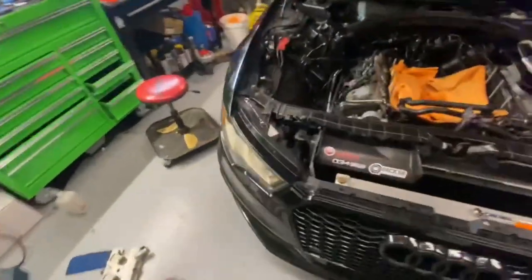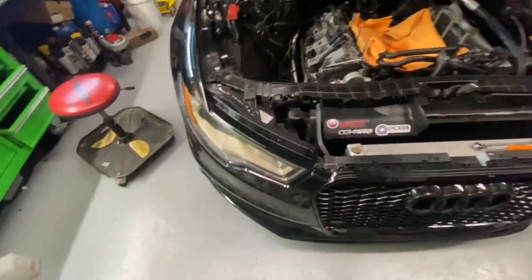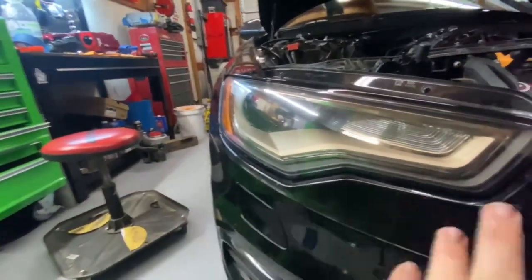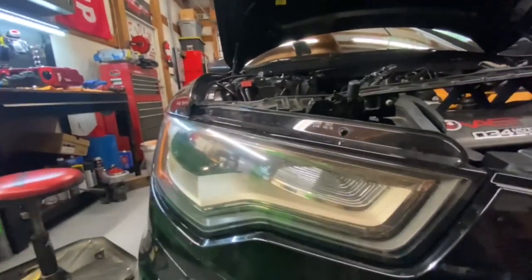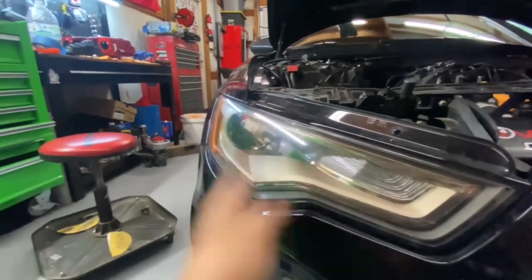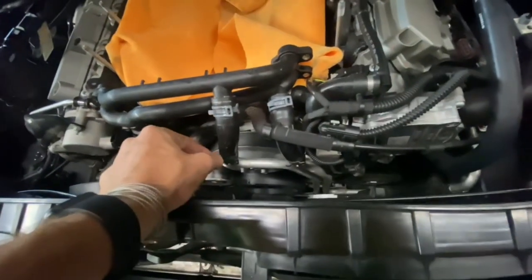But that's a good thing, because while it's off, I've been wanting to do this for a while. This headlight has stopped working completely. I've swapped the modules and it still doesn't work, so I'm assuming it's just the headlight. It's not just the bulb — there's no DRL that cuts on, no turn signal, no nothing. The only thing that cuts on is the side marker light. This works out good because this is the intake side, and I want to put the intake right here with no headlight. Also, I want to delete these hard hoses while they're out too.